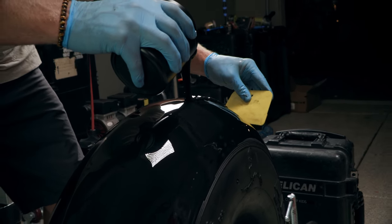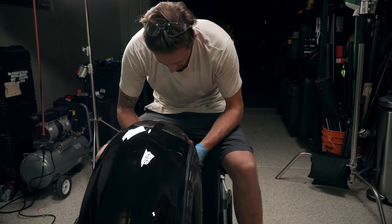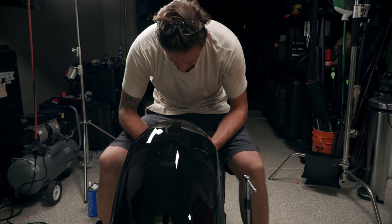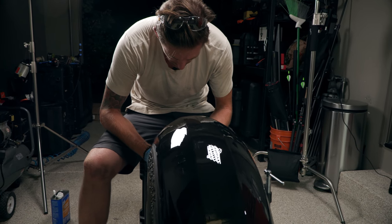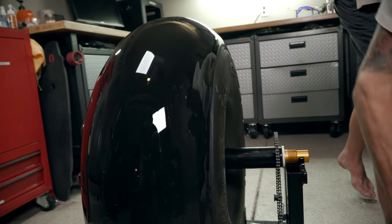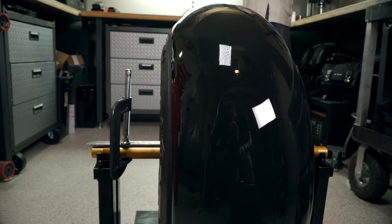This is where we build up the meat of the tire. We're going to build that on the crown of the tire. We don't care about the edges, we don't care about the center — build it where it wears. Leave the tire spinning for three hours, then it can be removed. It's four days to full cure.